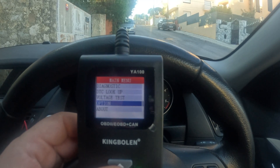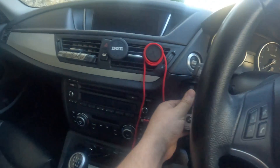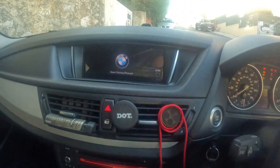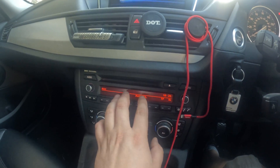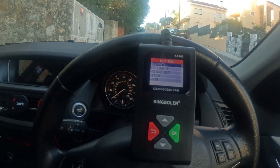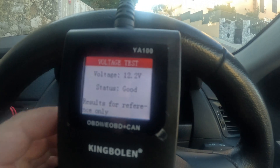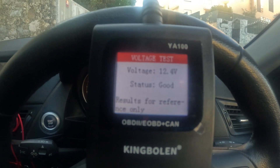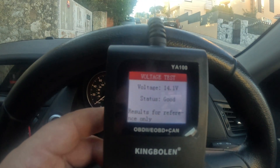This device requires you to turn on the car. I also got a new Android unit — that's going to be a whole separate video. I went back to the original head unit which is plugged in internally with an aux cable, but we'll talk about that another time. Let's do a voltage test — this is reading 12.2V which is kind of fine. Let's turn it on and see what happens. Yeah, it goes up to 14V, so everything looks okay.